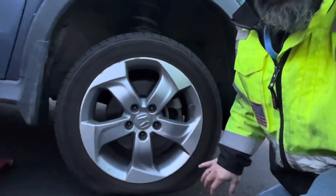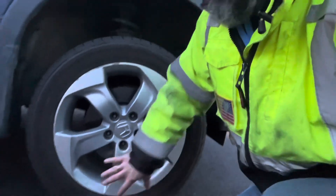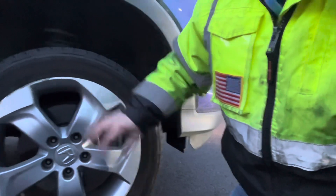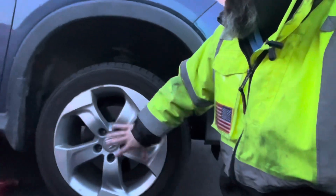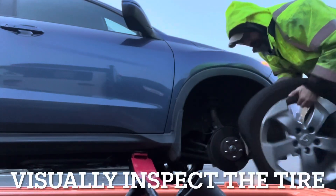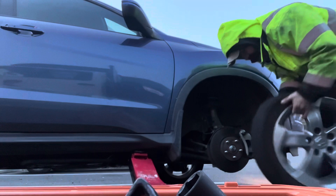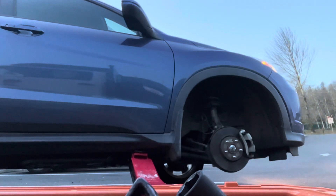We took the initiative and lifted the car off the ground. We basically detached the bolts before we lifted the actual tire off the ground so that way there's grip. Usually you have a problem once you get it off the ground because it spins, depending on whether it's front or rear. Anyway, we took the bolts off and now we're going to take the tire off. Tire's off, and now I'm going to go get the spare.